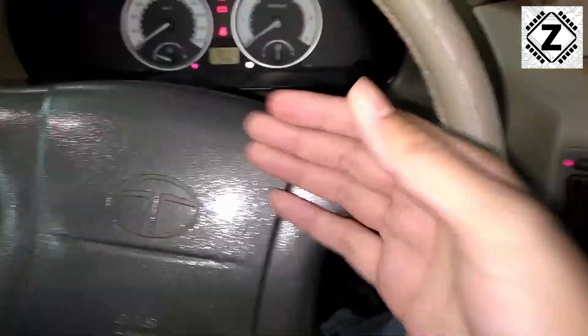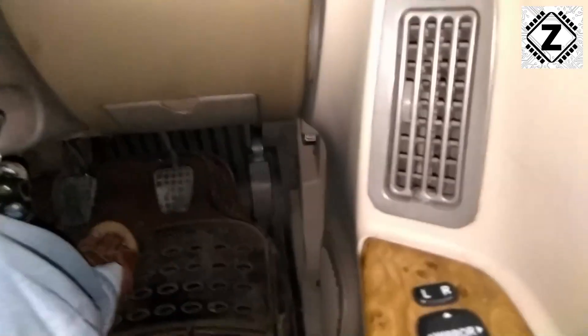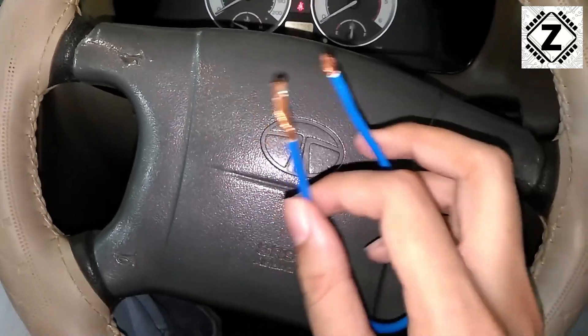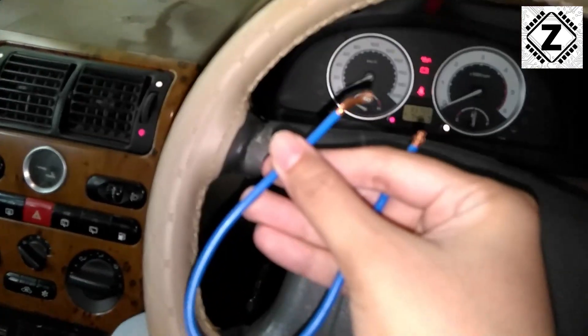In the next part of this trick, we need to pop open the hood. There is a latch over here — let me show it to you. We pull on it to unlock the hood. With the hood unlocked and window rolled down, let's go to the front of the car and discuss the emergency start procedure. We are also going to need a piece of wire — I have this thick 4 square mm wire. Make sure you always have bits and pieces of wire in your car as they can help you start the car or fix things when really needed.